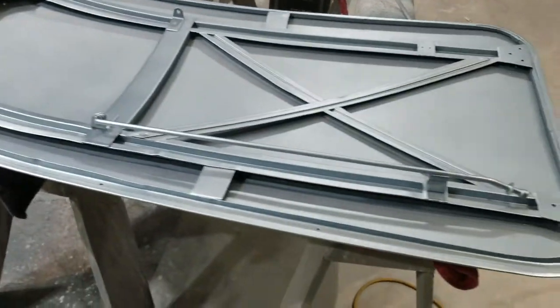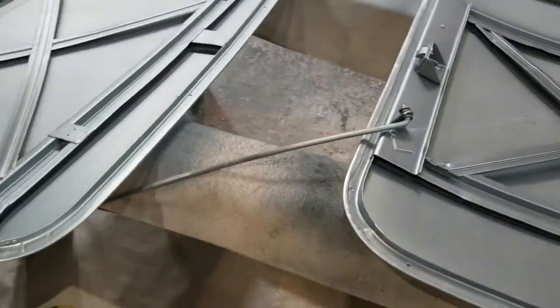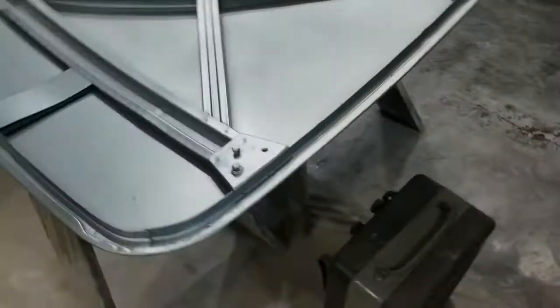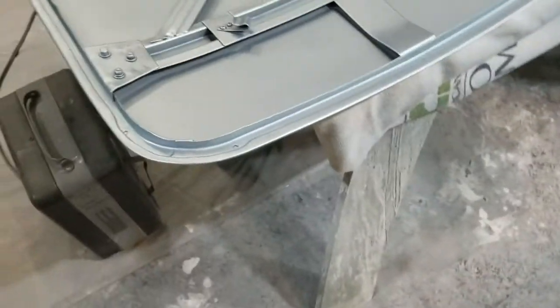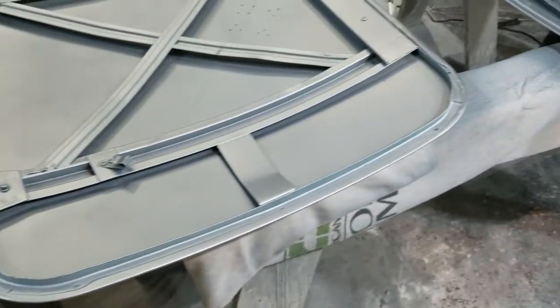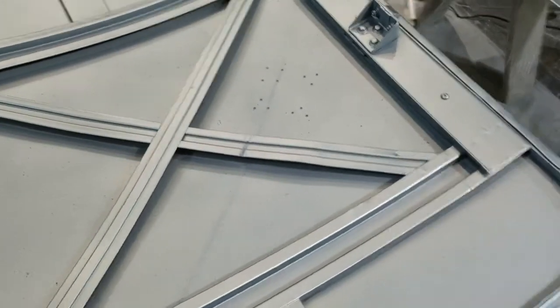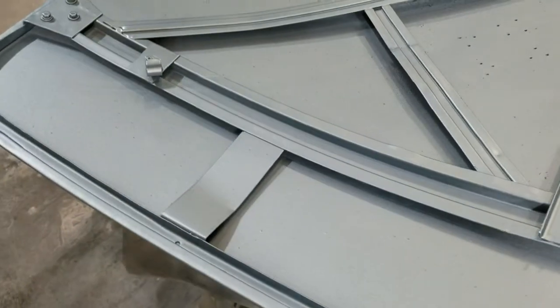And you can see that after 4 good medium coats, they weren't thick and they definitely weren't thin, it's pretty good. I cannot wait for the clear coat to go on. I've got 20 minutes left. You should do 30 minutes between base coat and clear coat. Again, you can see that line. Maybe from a different angle you can't, but this is good paint.